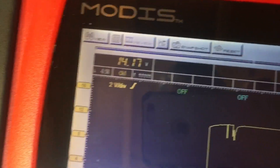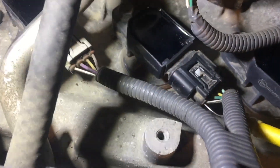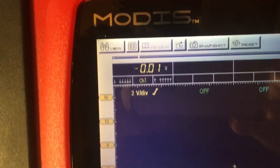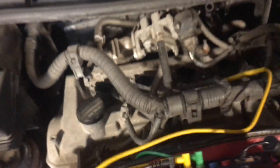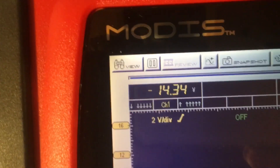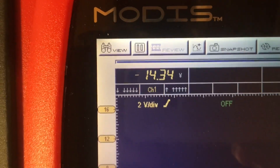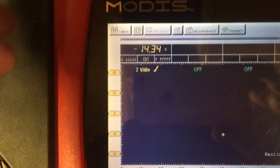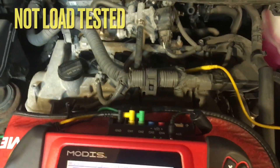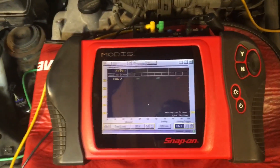You can see I've got the trigger set — when I turn the ignition on it came up to 14.7 volts. I'm actually probed on the ground line at the ignition here, so zero volts doesn't mean a great deal. Let me swap to a proper ground at the jump point inside the fuse box. Now I have minus 14 volts — if it were floating it would have remained at zero, so it's a good ground.